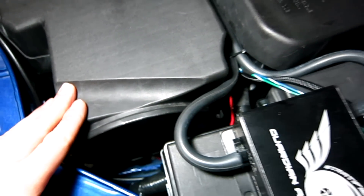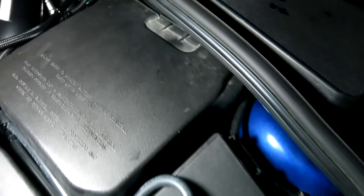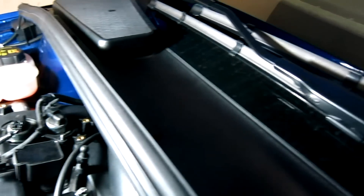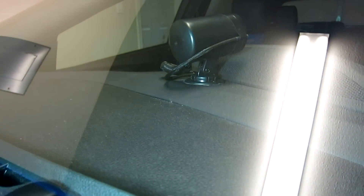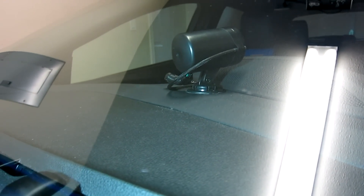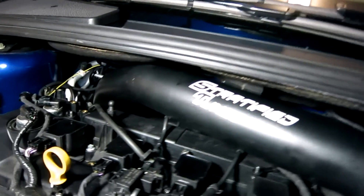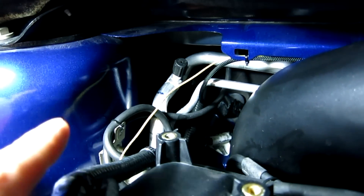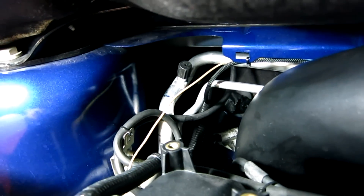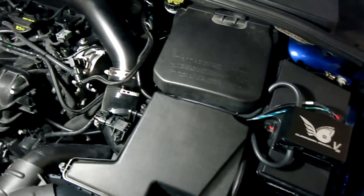You do have to remove the OEM airbox. The LED is routed all the way across the passenger side and into the cabin, mounted onto the cooling mist water-methanol failsafe gauge. The final connection is the failsafe trigger — we have this connected to our cooling mist failsafe. It's the yellow wire you see right here. If you watch our cooling mist video, you'll see how we ran the wires through the grommet on the passenger side. We connected this wire to the blue wire on the Guardian Angel, so should a fault be detected by the water-methanol control system, it will trigger the Guardian Angel and lower boost immediately.